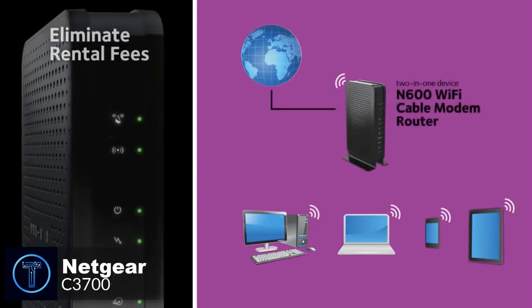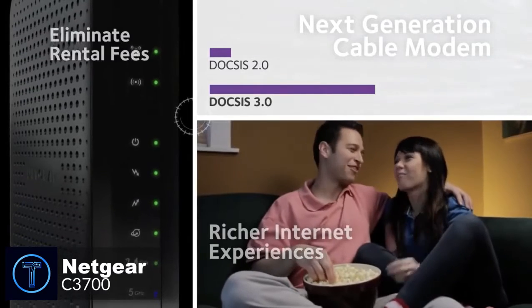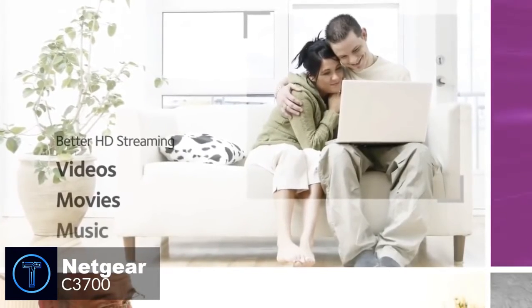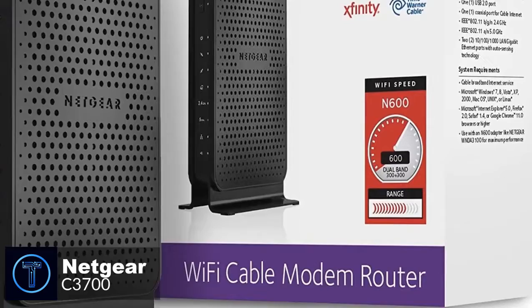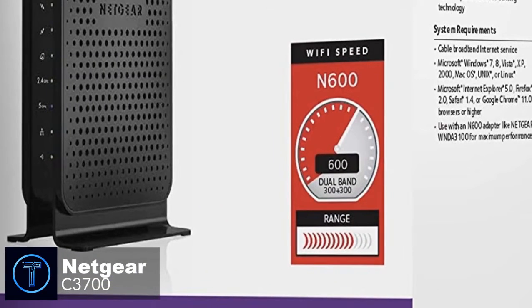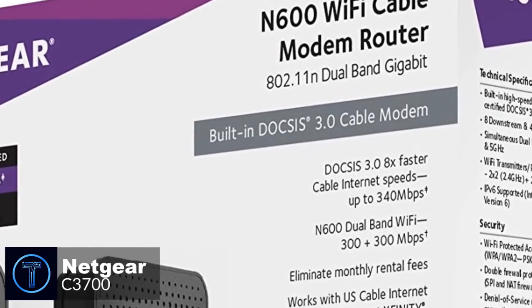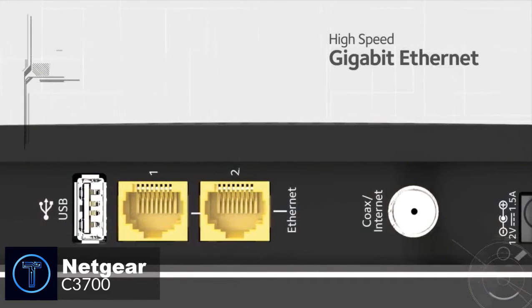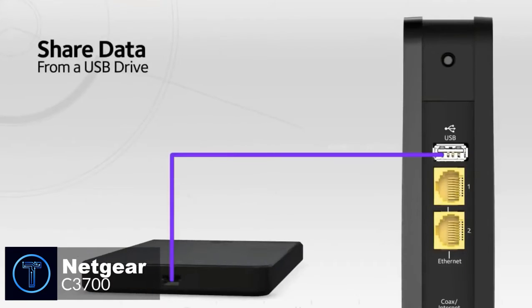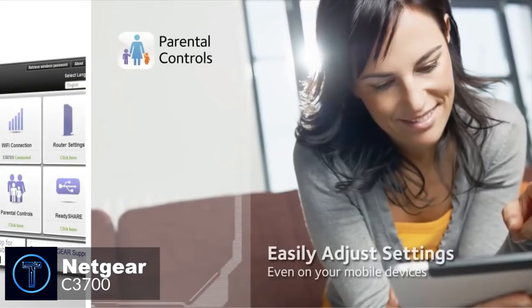As for performance, you can use the C3700 as both an excellent cable modem and a perfectly fine wireless router, provided you aren't streaming high-definition video among multiple devices or doing a lot of online gaming. The current crop of 802.11ac routers can deliver data rates of up to 1,900 megabits per second, but if you mainly check social networks and email or stream online video, the C3700 will work fine. This cable modem is DOCSIS 3.0 compliant and compatible with major US ISPs including Cablevision, Comcast, Optimum, and Time Warner Cable. There are gigabit Ethernet ports and a USB 2.0 port on the rear panel, and Netgear Genie management software allows for configuring an attached drive as a NAS.